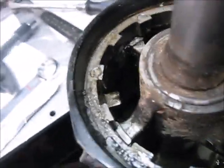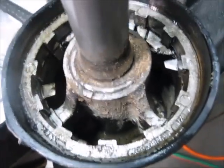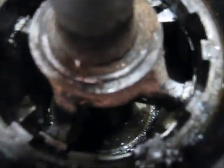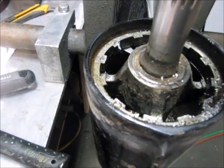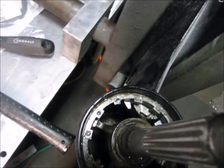We heated it up all the way around the outside here and it wouldn't budge. There's a good chance the integrity of the structure here is possibly damaged. So I'm going to pull this cover nut off - we'll put a center pop there and one on the other side, and we're going to drill a hole. It's got to go through about a half inch, and you'll know when you hit the bottom. You will end up hitting what they call a tab washer.